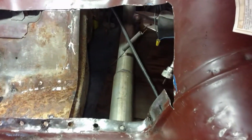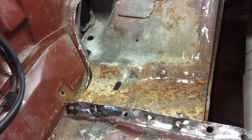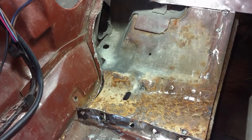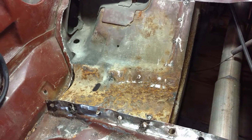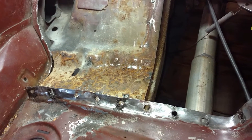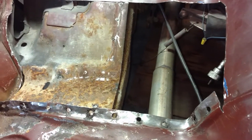So it's a good thing I got all of that out. You can see the rust from before and what we have now — pretty good lines across there. There are four spot welds across the bottom and four more right there. It fought me tooth and nail coming apart. Next we'll clean the torque box inside, sand it, grind it, paint it, and weld up the little nick marks created by the spot welds and grinding wheel.